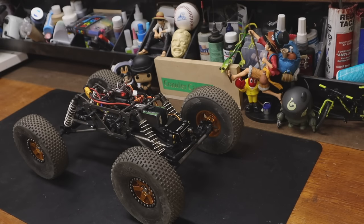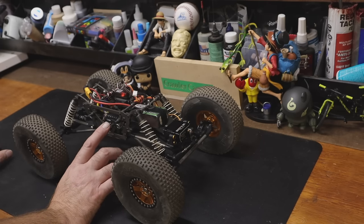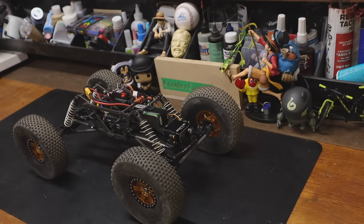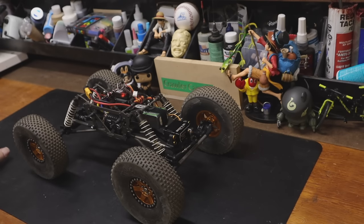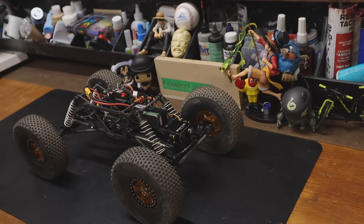So, I had the 1200 in there. Speed seemed okay. The motor, I've never seen a Fusion get hot before. But it got hot. So then I took some other electronics that had been salvaged from another rig that was sent in, threw them in here. Castle Creations, Mamba Mini, X2 Mini, the tiny little Mambas, tiny little guy like that. And a Holmes Revolver 2500. And it felt pretty good, but man, I really do not care for Castle ESCs powering outrunners. There was a big dead band. And after about 3 minutes of wheeling it, once again, the speed control was so hot. The speed control was too hot to touch.